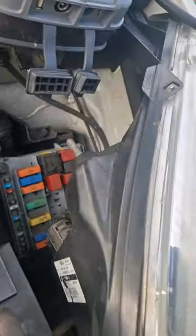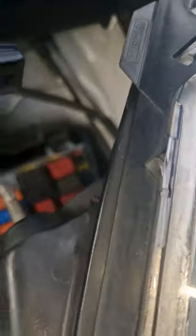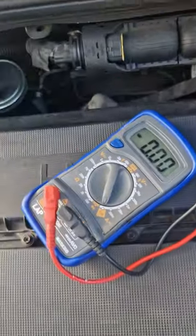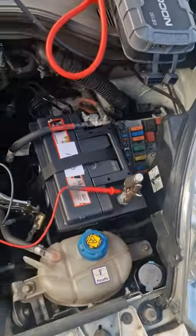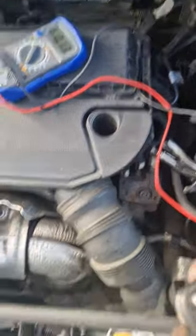So before we get crazy and start pulling out the radio, I just want to pull these fuses and make sure that they're all not contributing. Cut that down to zero by pulling this big boy here. So I'll have to check out and see what that was. Probably like the body control module. I'll just unlock the car quickly. It's fully done a reset of the car though. That was a real bad boy fuse that was. It's a car killer, that one.